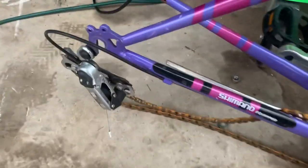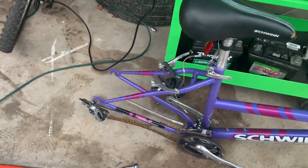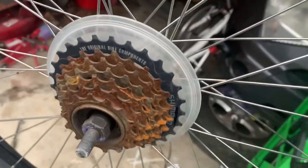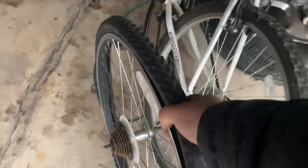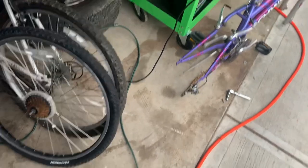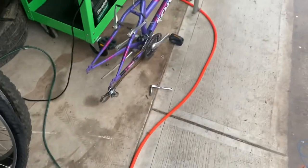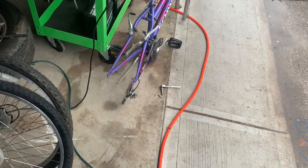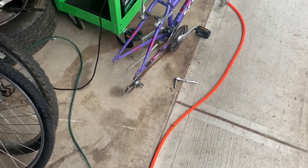Don't toss it out of frustration like I usually do. There we go — there's the derailleur, still in place. Once we put the wheel back on, once you pedal a little bit, it'll go back to where it's supposed to go. You can monitor: if it's on gear number one, it should be on that first tooth. The chain will automatically readjust itself. I'm thinking about doing a video on putting this all back together, but this is just a quick video on removing the wheel.